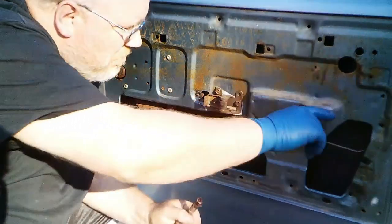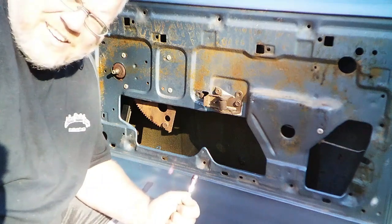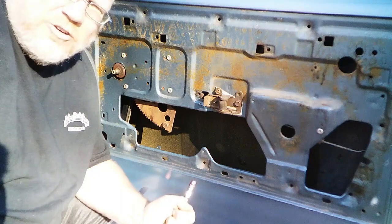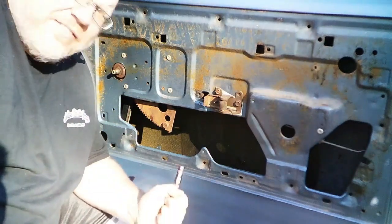And maybe spray a little silicone lube on the felts. They've all told me that they noticed an increase in speed of how fast the window goes up and down. And nobody has told me that they've had a motor fail since then. So even though I know these are manual windows, I think it still helped.